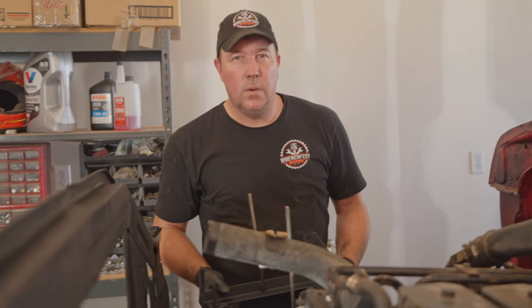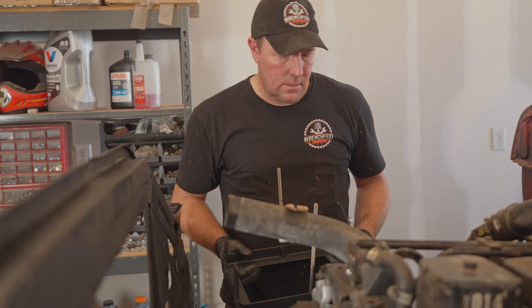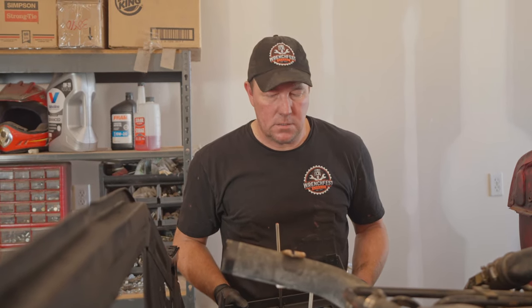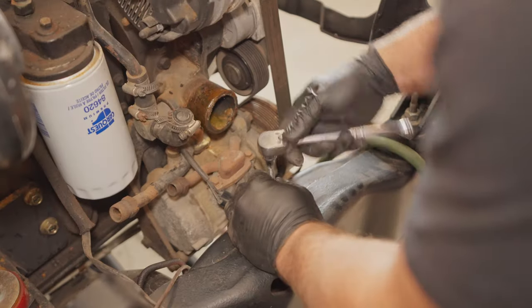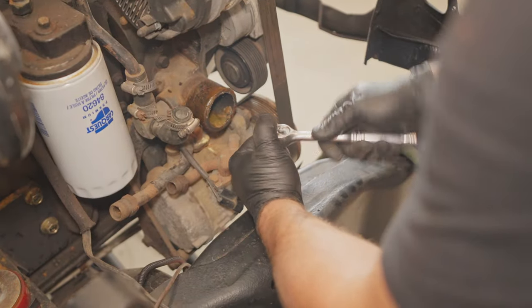All right, I gotta find a new home for the ground on this side for this battery. There's already kind of a spot here, but I think I might drill it out, tap it out, make it half inch. Give a little bit more area to hold on to. The trick here is to get it started straight-ish. Okay, I like it.